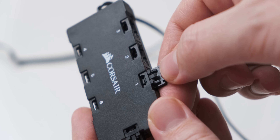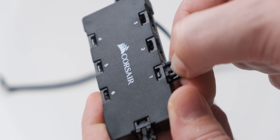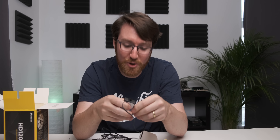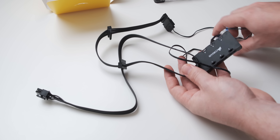This connector is an absolute nightmare. When you plug it in it sits in fairly easily, but getting it out is really difficult — the only way I figured out is to stick something in there and push it down, and even then it's a huge pain. On top of that, the whole connector requires an extra SATA power connection to power the RGB, which is really irritating if you're using a modular power supply with only M.2 SSDs, since you have to add a whole extra modular cable just to power this little interface.